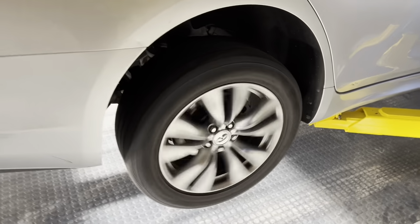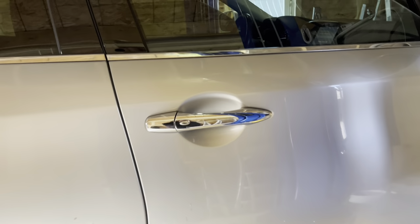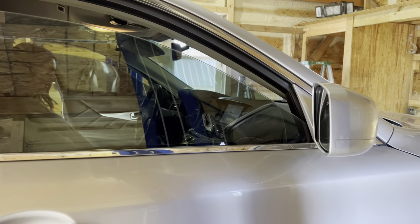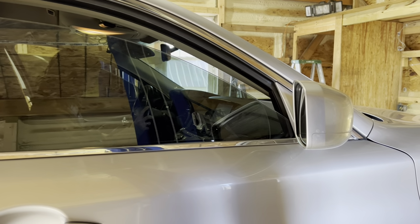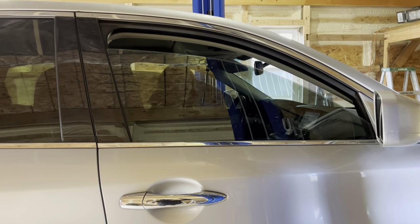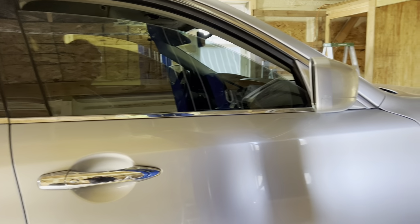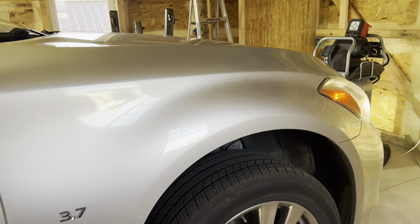All right, we know it needs rear brakes. I already knew that. So what she's gonna do is open the door and hop in. Try to shut the door, rev it up to bring it up to around 30 miles an hour. When you're testing this, about 30 miles an hour is a good speed. You're gonna have to feather the gas and play with it to bring the speedo up to 30. Don't stomp on it because the car will just go crazy. There's no load on it. So bring it up to 30.